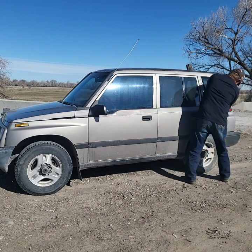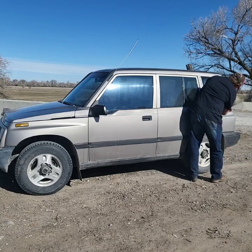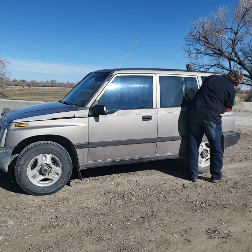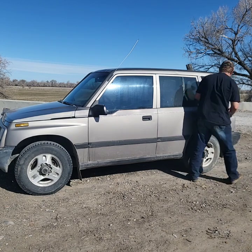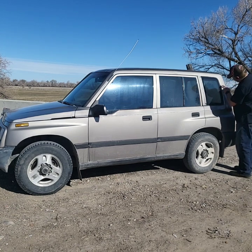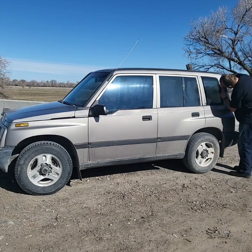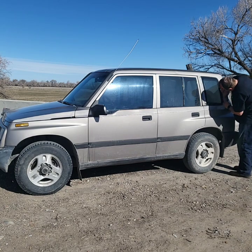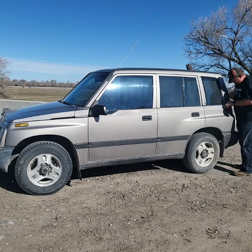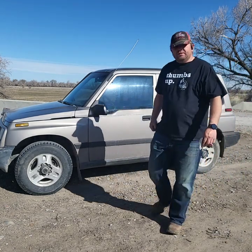Get into this back little corner here. We're gonna be a bugger right there, kind of. You get your finger on the sandpaper on the edge, just walk it along. I'm gonna tape it off and make a nice line right there. Take my tape about right here where it curves probably. Oh no, it ends right there, so we'll just go right up to there. So go down the window here. Now it's got a good scuff to it. It says on the can you can even use 50 grit, but that's what we're doing.